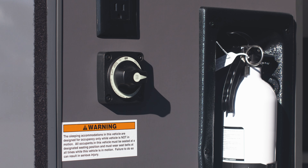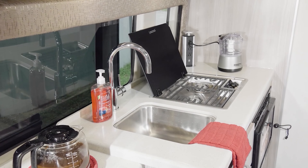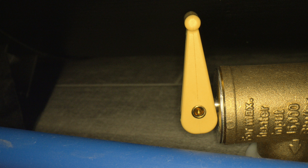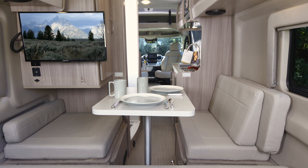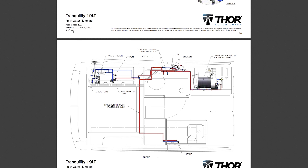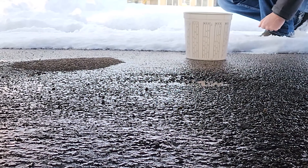Once the furnace is completely shut down, turn off the furnace's electrical power supply. If you're connected to city water, disconnect it. Now walk through your camper van and turn on all the water faucets, hot and cold. Once the furnace cools down, you need to open the Combi water valve to let the water drain — it's this yellow lever. Flip it 90 degrees to the open position. The location of the water valve will vary by floor plan. You can always find the schematics for your specific coach on the Thor Motor Coach Owner's resource page. Go grab a bucket or something else to collect the water in and place it under your low point drain.